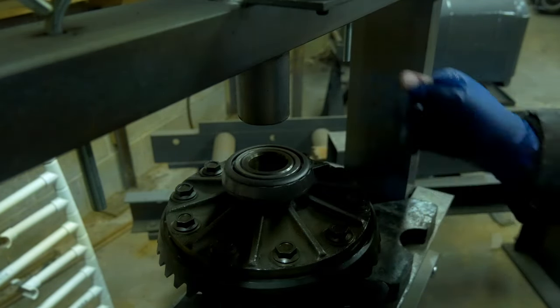If you're rebuilding an open rear end, which this one is, it is not a limited slip. There is no need, and I will repeat this, there is no need to put synthetic oil and overpay for synthetic garbage in your open dinosaur oil-loving differential. Okay, get the real stuff. Dinosaurs died for a reason. It's so you could put good oil in your differential. Now, if you do rebuild to a limited slip, either viscous limited slip, OBX, or the Quaife, however you pronounce all that stuff, then yeah, sure, go with the 75-90, the synthetic stuff, spend the extra money, because it does have additives that are a requirement for that limited slip to function properly.